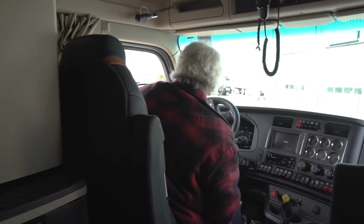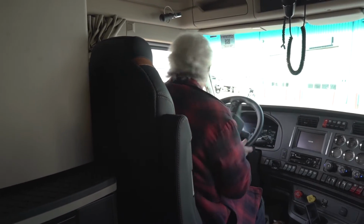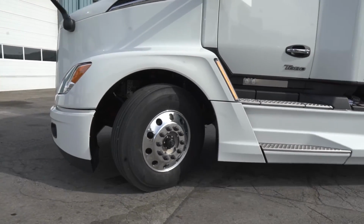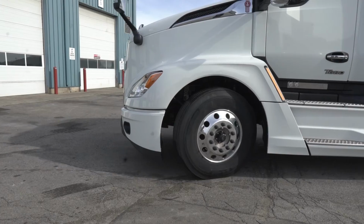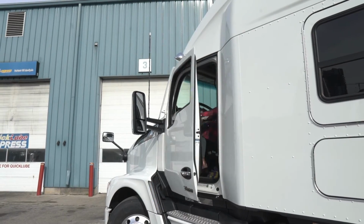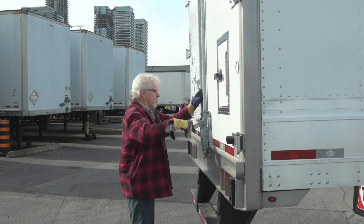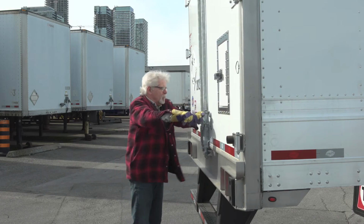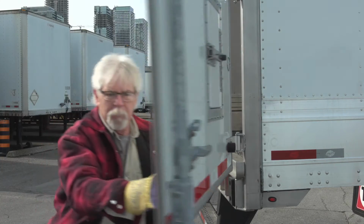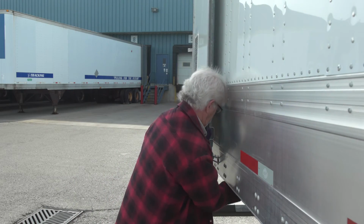As you're turning, watch the mirrors for the gap between the 2 trailers you're trying to park between to appear in your mirrors. If you have enough room to pull far enough forward, you'll find yourself straight and directly aligned with your target. Before you complete the backing maneuver, exit the cab and open the doors. Make sure the doors are held securely open. This also provides an opportunity to make one final check of the pathway into the dock. Make sure the way is clear.